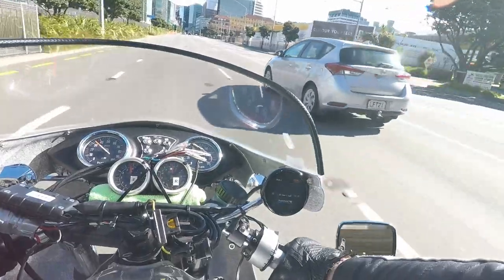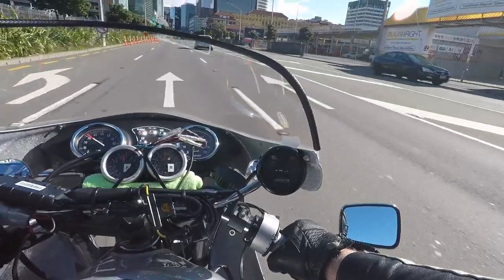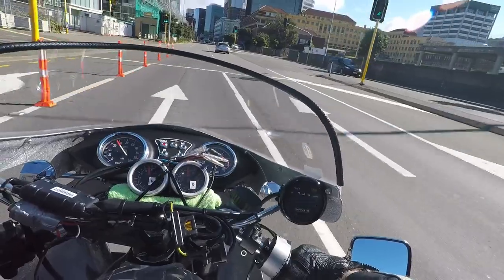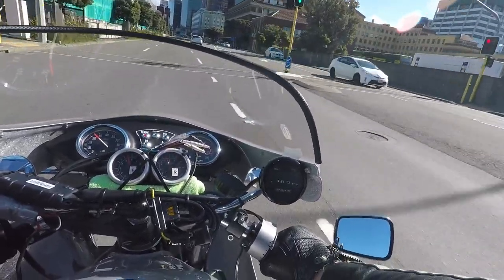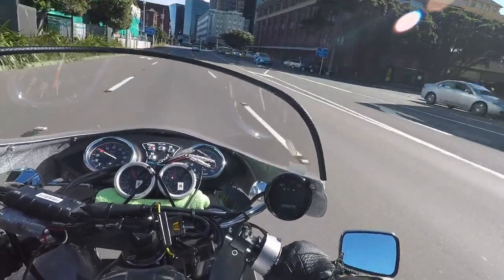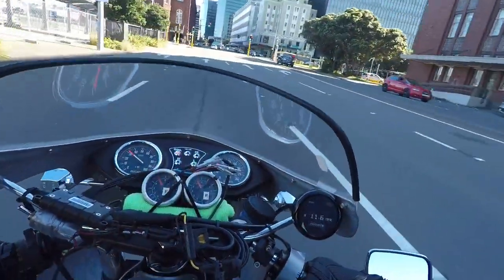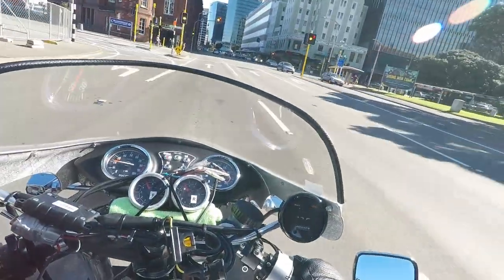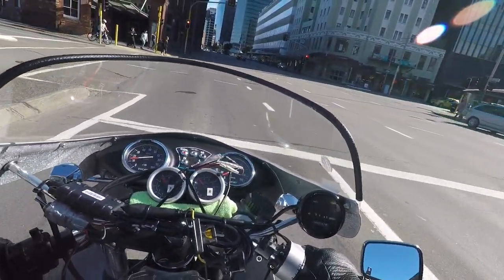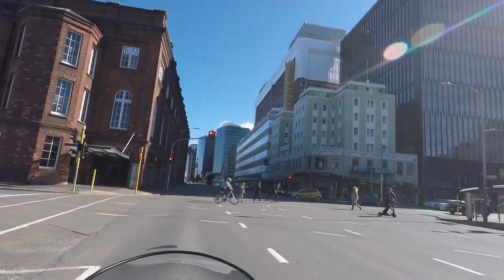Yeah, it goes a little bit rich. But I'm gonna give it a hard throttle here. Still wasn't full, but pretty good. I think I saw the bottom one go up to 14 something just then. Try it at very rich. Oh boy. I saw the top even go to 18. That's interesting. Yeah, shouldn't we be seeing it go richer?